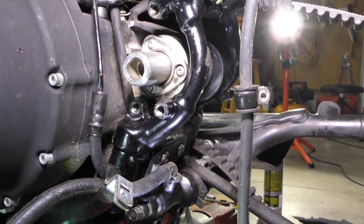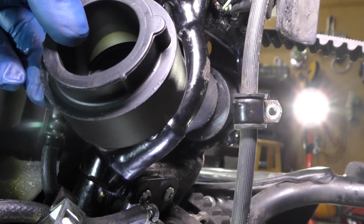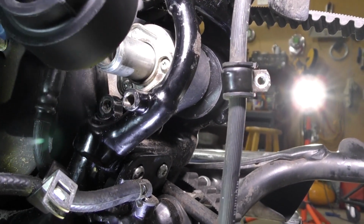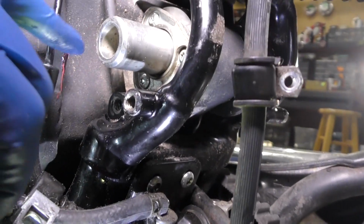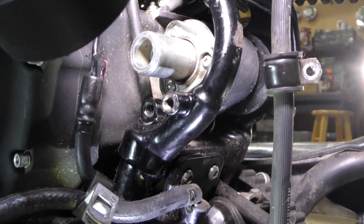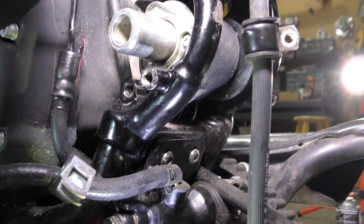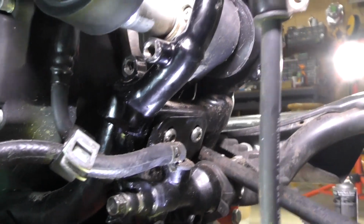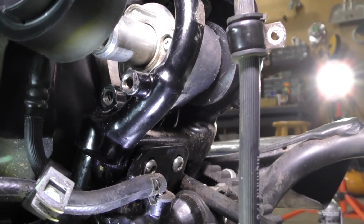Okay, everyone, I got the cap back on. So now I'm gonna try to put the other rubber motor mount in the left side. It was hard getting this one out, so I imagine I'm going to have a little trouble getting it in. I greased the side of the motor case there because it's a very tight fit, so it's going to take two hands, so I'll have to struggle with it here. And these tabs, they got to fit in the plate that I put over there, but you can adjust it after it gets in.